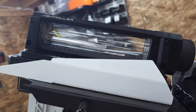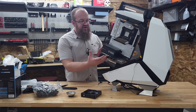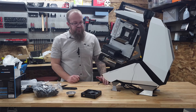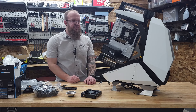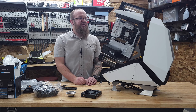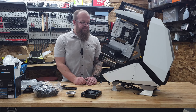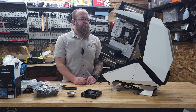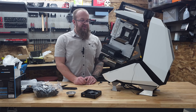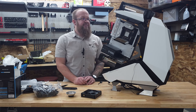Let me mount the power supply, and then we'll get into closing comments. Power supply is on, and it's rather adorable for a thousand watts — it's actually quite impressive just how small they've got. Whenever Asus puts out that 1200 watt Loki, that'll be impressive too. There's no reason what I have shouldn't be sufficient — we should be good running a thousand watts with a 14900K and potentially a 4090. You'd really have to do some overclocking and push it in system testing to hit that thousand watts; you're definitely not going to see it in gaming, video editing, or SOLIDWORKS.